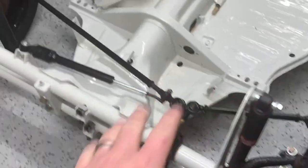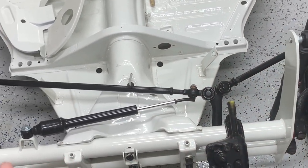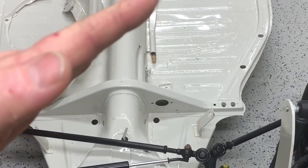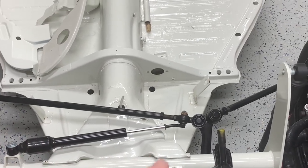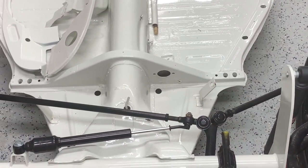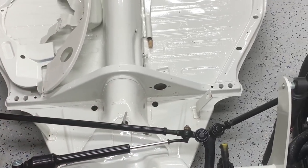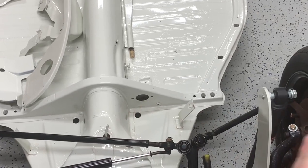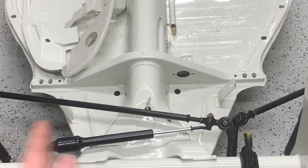All right, so here's the Bandit chassis. Now, I was just going to use drop spindle disc brakes on the other front end and just lower it that way, to get rid of the squat, because I'm not into the squat. I wanted to get that nose down. But the problem is I changed my wheel and tire combo since I started blowing this car apart, and now with the wheels and tires that I'm going to run, it'll be too wide. And that's not cool. I'm not going to do that. So the only way to remedy that is to go with the 2-inch narrowed beam. And that's what this is right here.